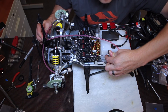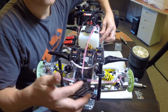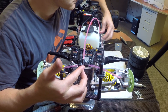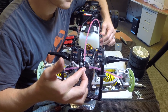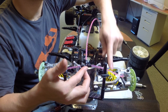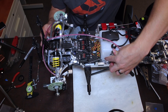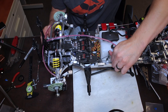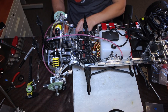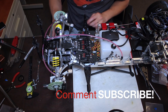I'm putting a bit of force on there. If you look at the left front caliper, you can see there's a couple of bubbles starting to form. That indicates that once you started moving the master cylinder, you were getting a little more brake fluid pushed around. Those air bubbles mean you'll just have to re-bleed the system again, which is no big deal — that's pretty common the first time. Repeat this process by loosening one of the valves on the caliper and then loosening the valve on the master cylinder.